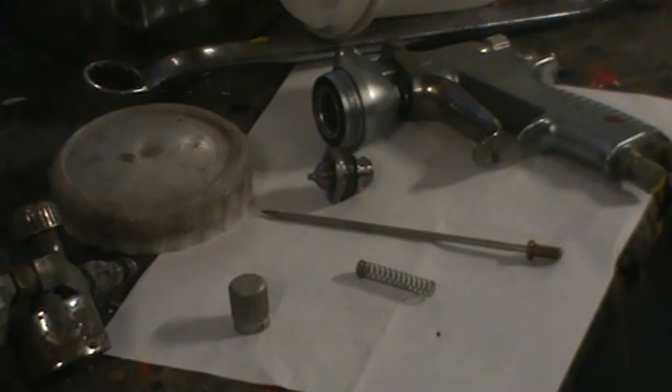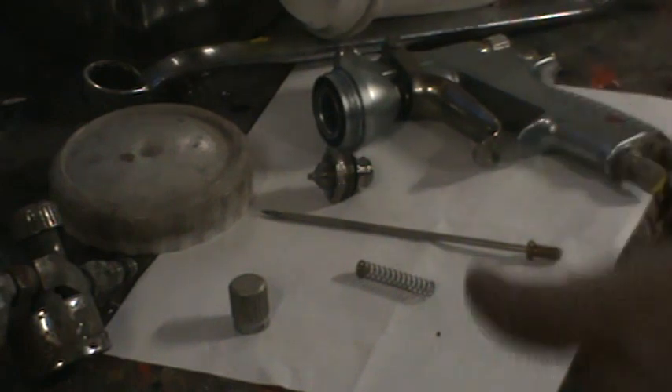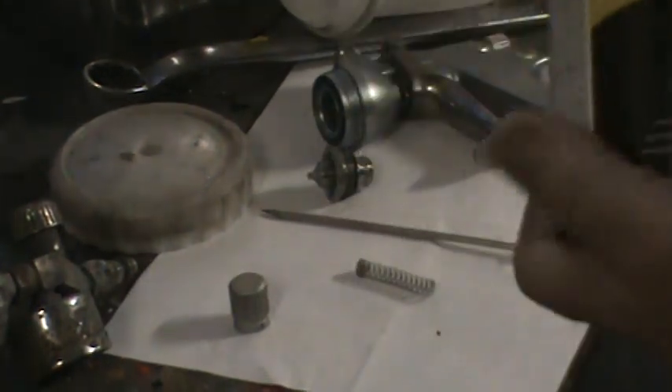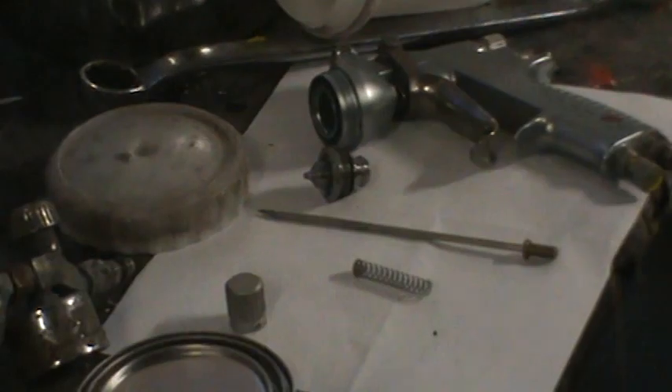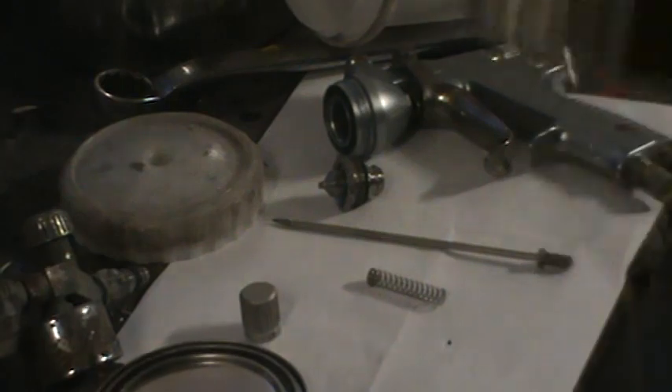The PPS cup also gives you an easy way to store your paint, although I never liked the look of them. You can run into issues with unlabeled PPS cups if inspectors come into your shop. I worked at a dealership - if you're a shop and you have no labels on your cans, it's a ten thousand dollar fine per can. Every paint can in your cabinet without material data safety information on the label is considered a ten thousand dollar fine, because that's required by law.